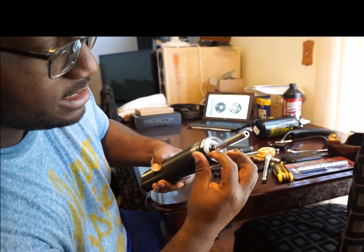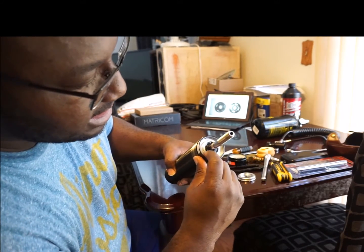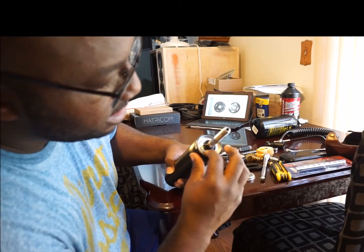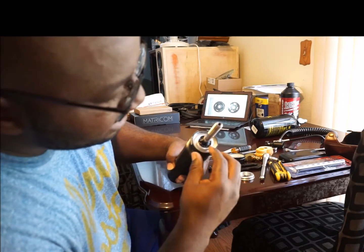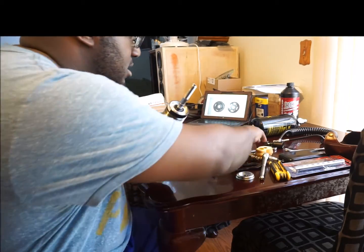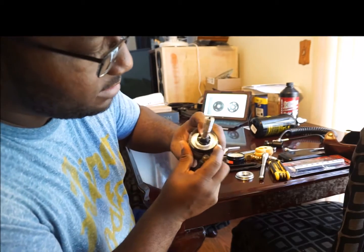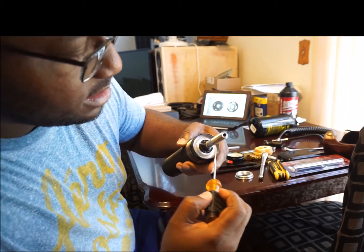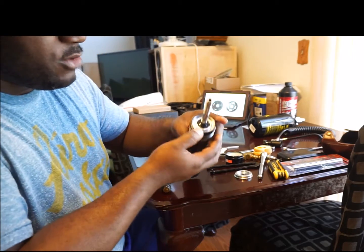If you look here, you'll see the black rubber portion — this cleans the shaft as it goes in and out. That's connected to this little cylinder piston here. The purpose of this is just to wipe the shaft, but if you look deep in here — I don't know if it can be seen on camera — there's an actual c-clip that goes around the edge, and there's a little cutout on the inside of the shock body.